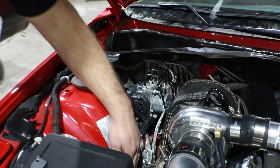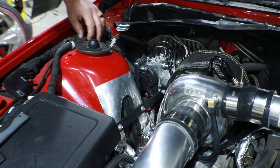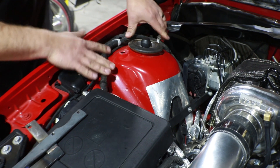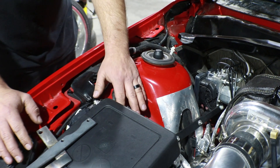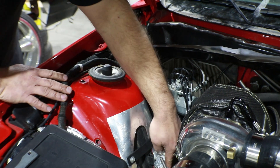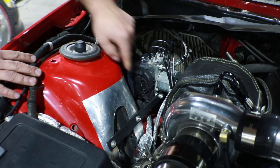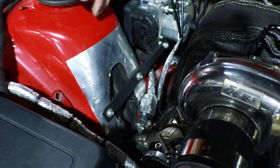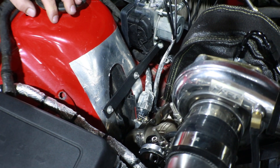The other variance is instead of running the wiring down across the bottom here where it was real close to the heat, the SS actually has enough wiring that we're going to pull this up and run it over the top of the strut tower versus down on the side of it along the frame rail. We can unplug from here, reconfigure some of this, and take all of that wiring that was on the top of the frame rail and bring it up here. The only thing that's actually down here now, heat wrapped, is the actual plug for the ABS sensor going out into the wheel well area. All of that we're still going to go ahead and heat wrap and tape up.